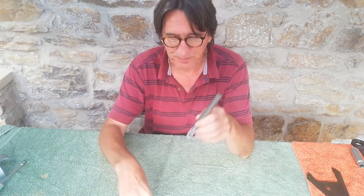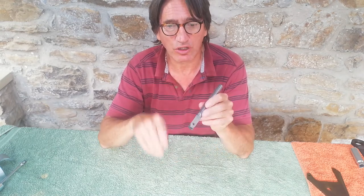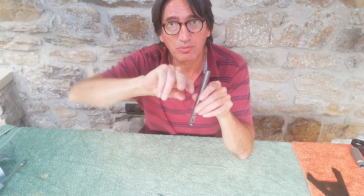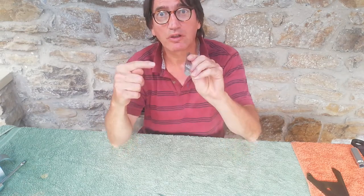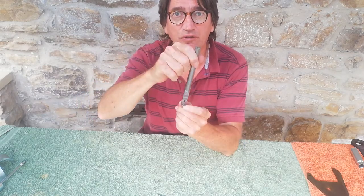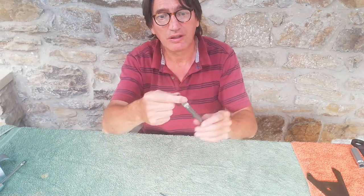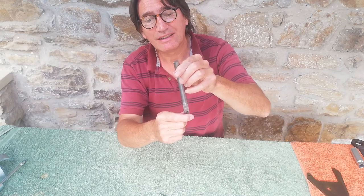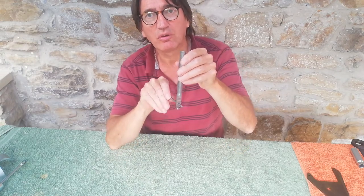This is an extra tool not listed in the manual — it's a special tool for aligning the rocker shafts. It's very important on a Commando that the rocker shafts are absolutely in line to make sure the oil ways line up. If the rocker shaft is slightly at an angle, the drilling inside it for the oil way won't line up. This edge fits into the edge of the rocker shaft so you can turn it to exactly the right place, and this little pin slots in when it's in exactly the right position.